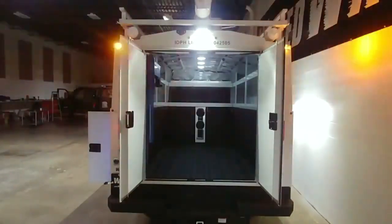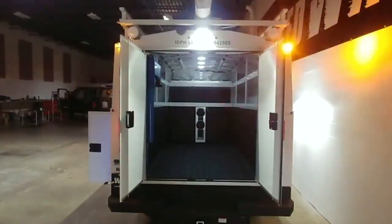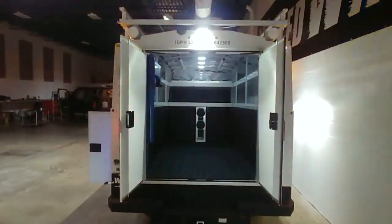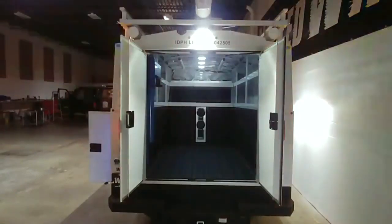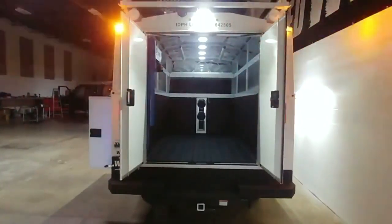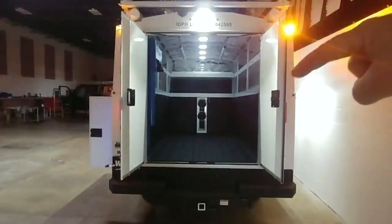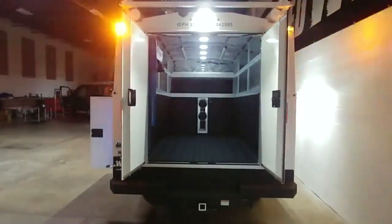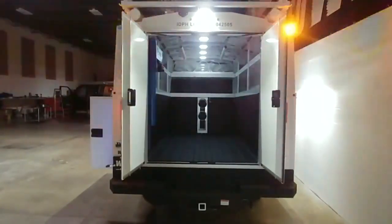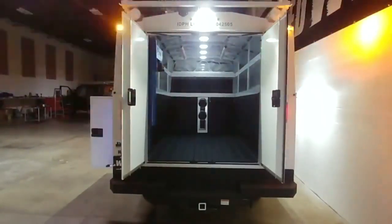We did a little inside lighting as well. Inside the van we've got five interior lights lighting up that whole interior real nicely. We also had spray-in bed liner applied to the whole inside of the van, as well as custom racks for the tools this owner needs. For switching, we have one toggle switch inside for all the white lighting — it's battery-fed so we can run it anytime. We have another switch on the dashboard in the cab that covers all of the amber lighting. So it's a very simple two-switch system, easy and quick to put in.